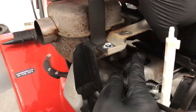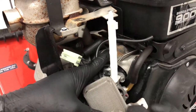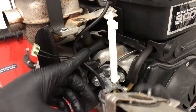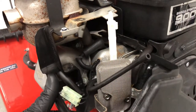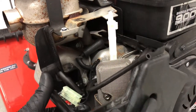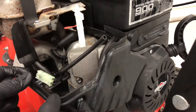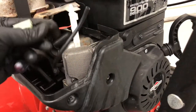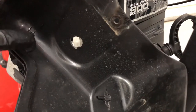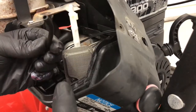Put your spark plug boot on and feel it to make sure it's seated inside the metal hole. Make sure the choke line is on and the fuel line is on the carburetor. Now put the air filter back on nice and tight. Take the plastic piece that goes on the bottom, put it over the top of the fuel line, and feed it into the hole. Route the wire that goes to the switch and connect the two connectors, then put the switch on.